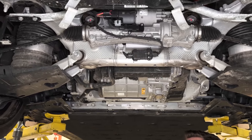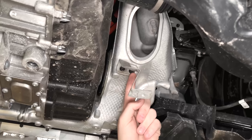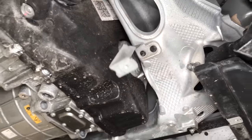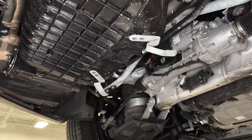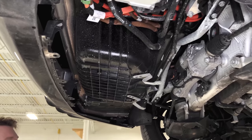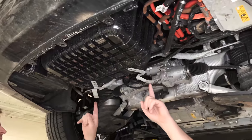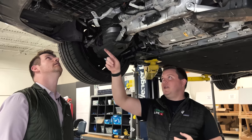One thing I don't like about the cradle is these extra brackets hanging down. These are add-on steel stamped brackets — they even have a little locating plastic push pin. This is what you'd see on a piece of trim — a really nice fastener and then at the end of the bracket another fastener — all intended to be a spot to mate for the rear shield. You see similar brackets bolted to this rear tub here, which looks to be an SMC fiber composite rear tub. At Monroe and Associates we always preach integration — why couldn't they have developed the mounting provision right into the tub itself?